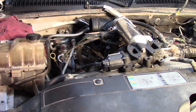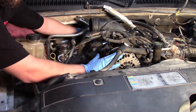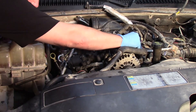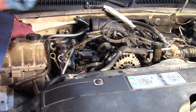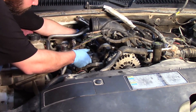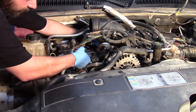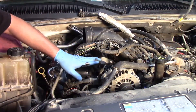This gives you a much easier level of installation than if you tried to put that stud in first — you'd need pry bars and possibly another set of hands to get everything moved around. That's the best way to do it and that's how we're gonna do it. I'll loop this hose on the other side of the alternator because there are gonna be some studs and things in the way that would prevent me from getting this flush with the exhaust. Now we can take our stud and work it in from the back — make sure your gasket is aligned on the bottom as well so the stud goes through properly.